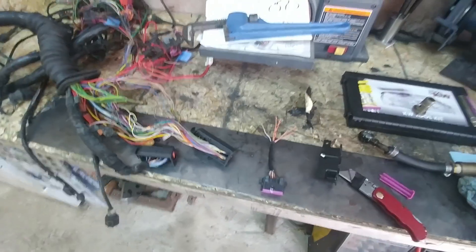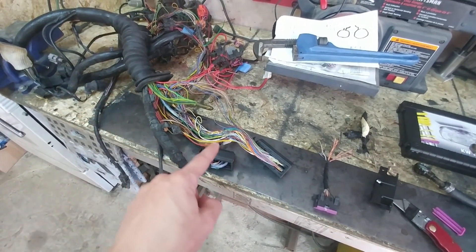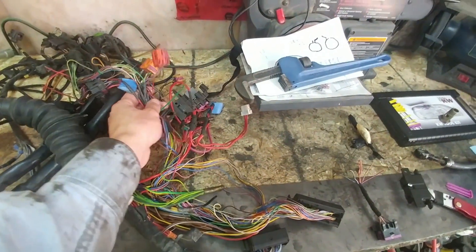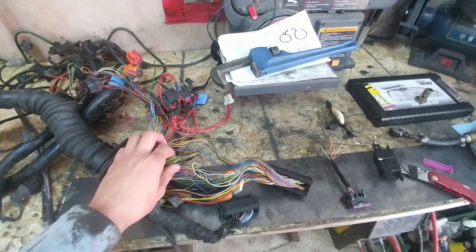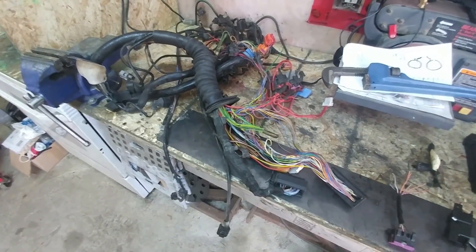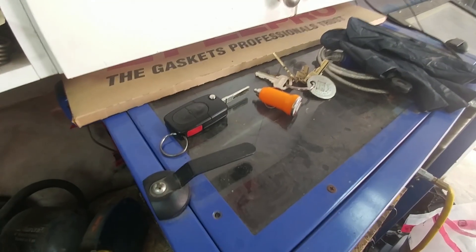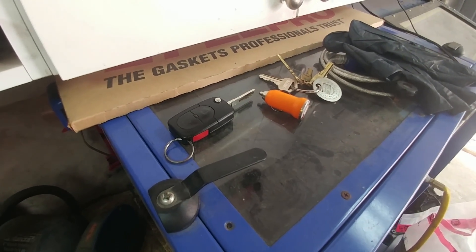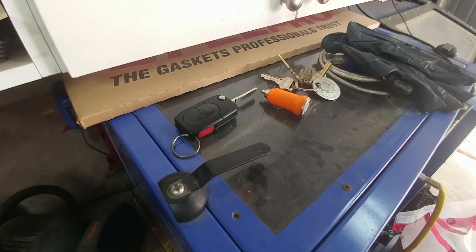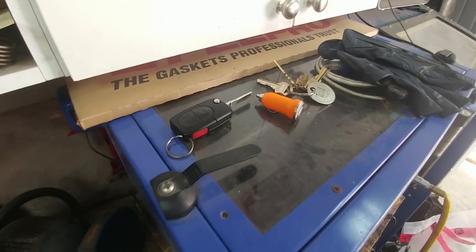Here you can see what I'm working with to make the bench flash setup. I have an OBD2 port cut out of an old Jetta and the hacked engine harness from the original 4.2 car that the shop completely mangled - two sets of body harness plugs, lots of splices and cuts. I'm going to connect these together and also use a cigarette adapter to run power. It's way easier and simpler than an adjustable power supply - just get in a car, run it, and use that as a power supply.